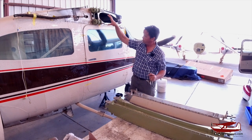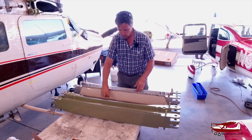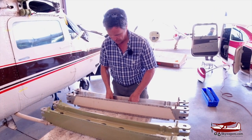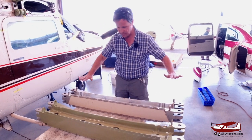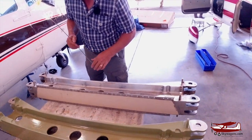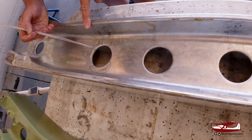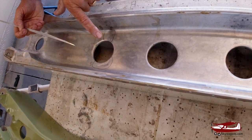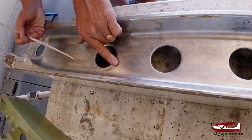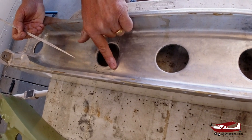So that's been replaced. This is what came out. These things weigh — I mean, that's like 30 pounds of cast aluminum. This one has failed. And the reason why, if you can see closely — it's hard to see — but see that corrosion right there? That is like a mild depression. Not as much as the depression of the owner who discovered it, but that is enough to condemn this.